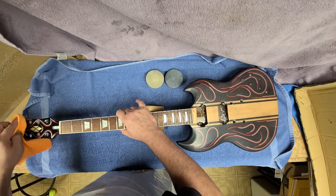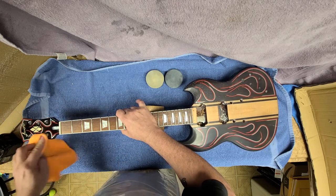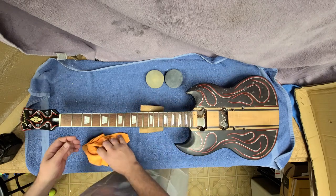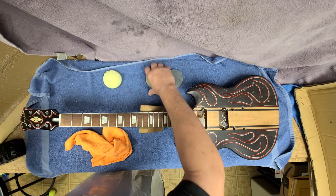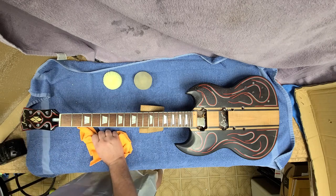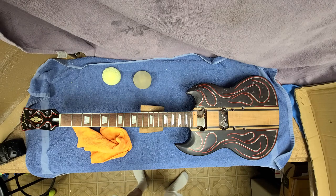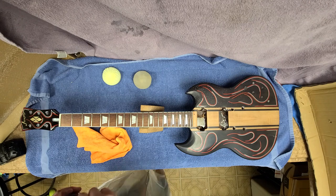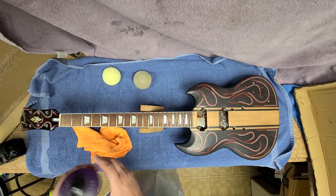Alright, so now I can hit it with the second cutting cream, which is a lot milder of a cut than what this one is. Yeah, I'm already wearing this out. Now I do have the different colored pads for different cutting creams, because each pad is a lot lighter than the other pad. And I just put a little bit in the middle.